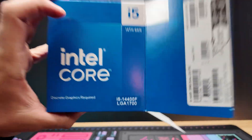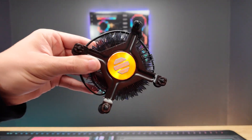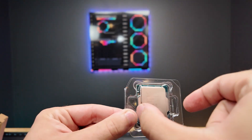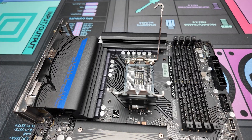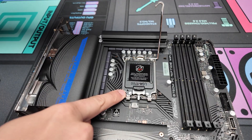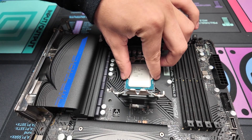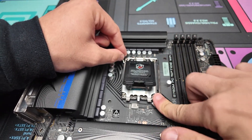Use the box cutter to open the CPU. The box has the CPU and the cooler inside. Right now we just need the CPU — be careful taking the cooler out because there is pre-applied thermal paste; do not touch the bottom. Grab the CPU on the sides. Push down the lever to release the socket, and you'll see either a dot or a triangle on the CPU indicating orientation — there's a matching one on the socket. Gently place, don't push, the CPU into the socket — it just rests in there with no clicking — then close it back up.